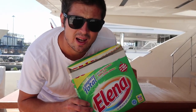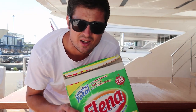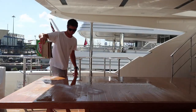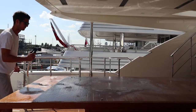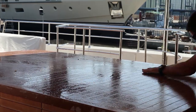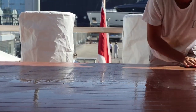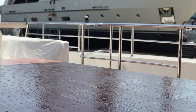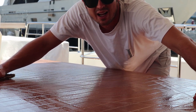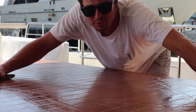You can sprinkle the powder straight on — the granules are what get into the teak and clean it out nicely. It's better to put the granules straight on as opposed to putting it in a bucket first. The more water the better; add a little more water to mix it in with all the powder. Now use the doodle bug — you can also just use it with your hands and get in nice and deep. Remember, always scrub against the grain. I usually just go over the same area a couple of times — three or four — but probably two is enough.